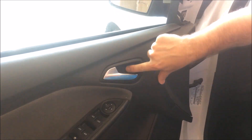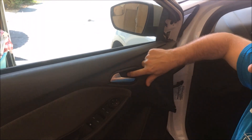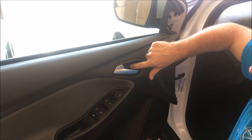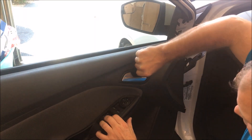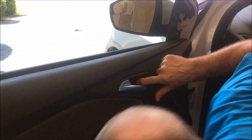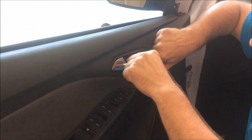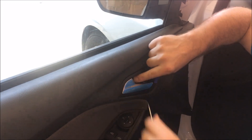There's a screw right in here — it's a Torx 25 — and it's got a cover over it. Fat Guy Builds figured out how to get this out: it's actually a push and a pull. If you push down on one side, it'll pop out part of it, and once you do that, you can get a thin screwdriver on the other side and pull it out.